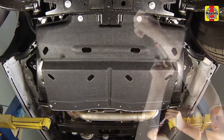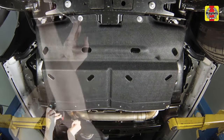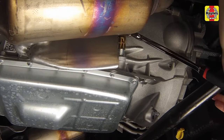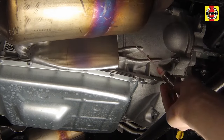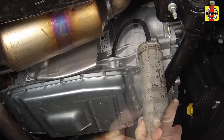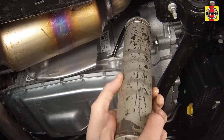Remove the under-engine rear cover. With the engine off, remove the transmission fill plug and dipstick from the right side. Using a proper siphon kit or suction gun, remove as much fluid as possible from the transmission. Save the fluid for measuring purposes, but do not reuse it.